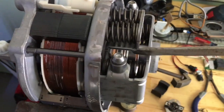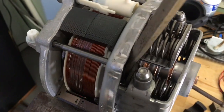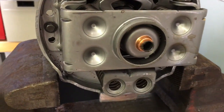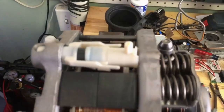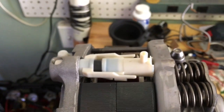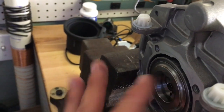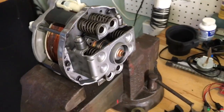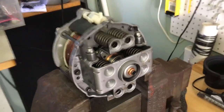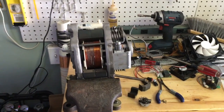Here it is from another angle. This is the part that I was pushing on — make it go up, and then that's the part to make it go back. And that's the part where our gas goes into it. The only part I'm really not sure what it does is this one here — I'm thinking it's a lubrication port, because there's a little channel that goes down into the sides, and then on the other side there are two little ports inside of the chamber. I just don't really know. If anybody does, feel free to comment. I hope you guys learned something — I thought it was a pretty cool glimpse into a linear compressor.